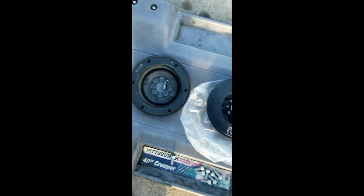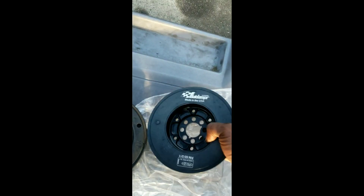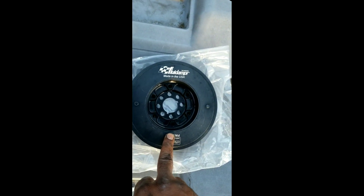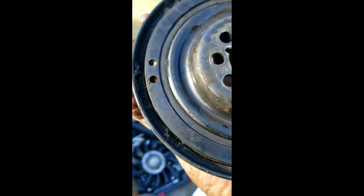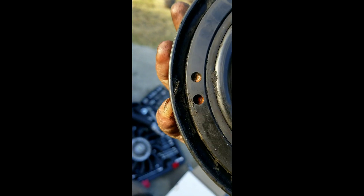This is the fluid damper right here — this is the old one. The fluid damper is a little bit heavier. I looked it up and someone weighed them: this one is 4.6 pounds, this one is 7.2 pounds. The difference is this one just has rubber to help deal with the torsional vibration. What happens is these get old and that rubber starts cracking — in some cases it even comes out. I checked this one and there was one little crack starting.